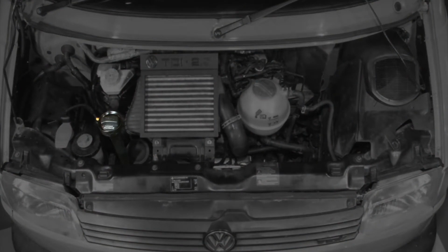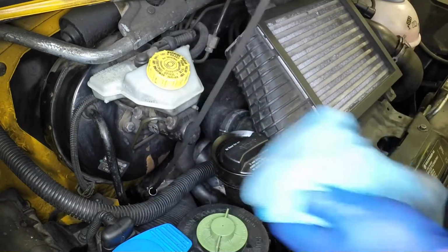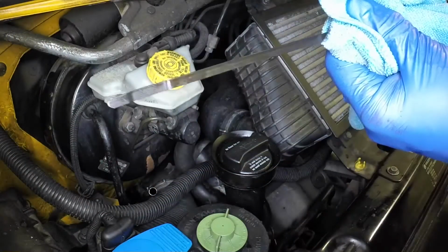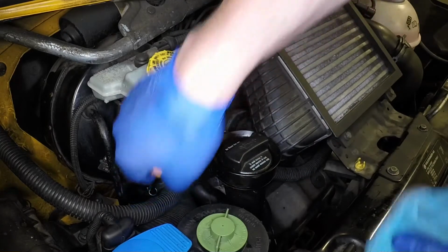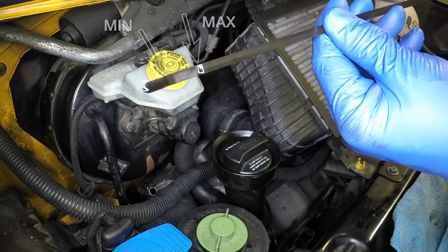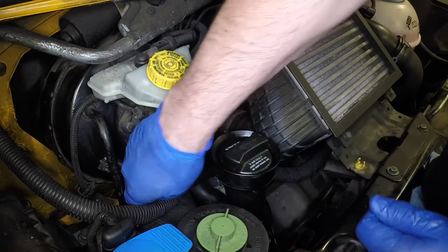The engine oil level dipstick is often brightly coloured for easy identification. Pull out the dipstick, wipe it clean, then fully reinsert it. Withdraw the dipstick again and examine the oil level. If the level is below or near the minimum mark, topping up is necessary.